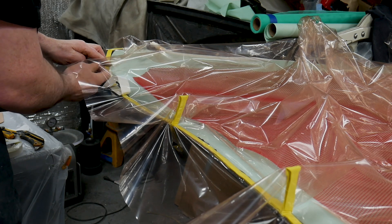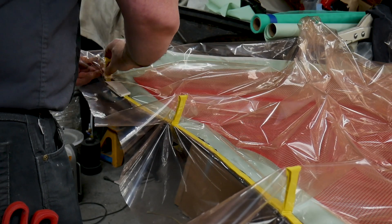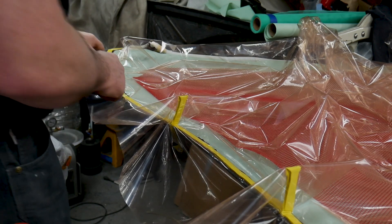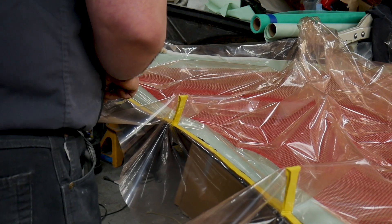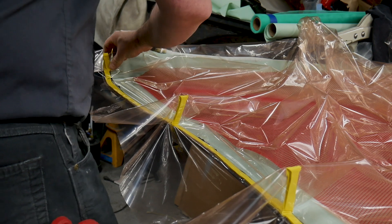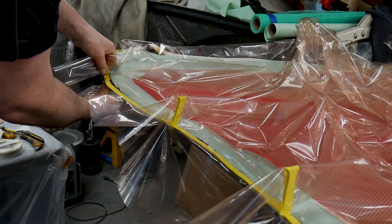Just one last go-around on how to seal up any one of the sides for the perimeter of the bag. You can hear how crunchy that film is. We've laid out each one of those pleats going from right to left. I've inserted the last pleat and made sure that the pleat can pull the bag tight down onto that last little bit of perimeter. As soon as I'm happy with that, I sneak into it — I've pulled off the last of the backing for the tacky tape, got it all the way into the corner. Now I pull the tape off of the pleat and make sure when you do this last little bit of sealing — there we go. I pull that bag down and then pull all the excess bag up the pleat. That gives me a perfect seal along the edge.